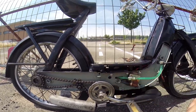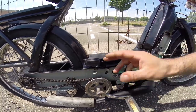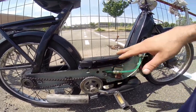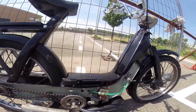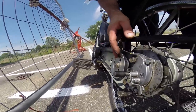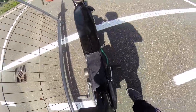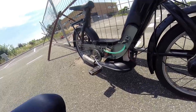I needed to replace it, so now I mounted the very small 10mm diameter carburetor — the original one — so very limited in performance, but I want to run in this condition with the stock Polini filter. Here you can see I mounted the original 19mm diameter pulley with the proper belt. Now we check if it will run — and it ran!